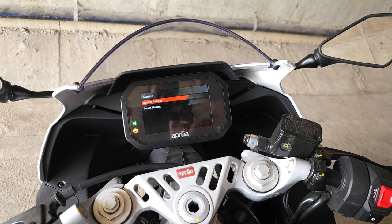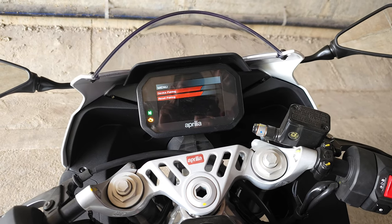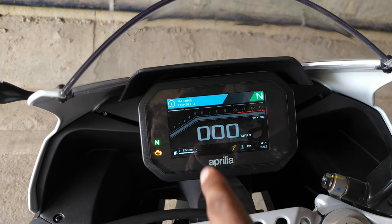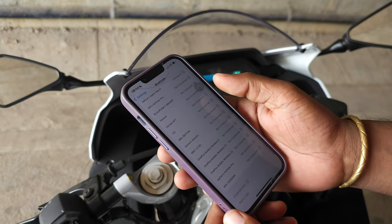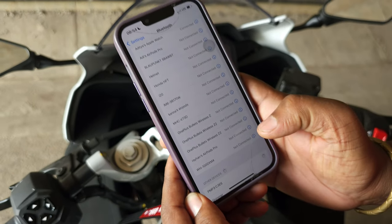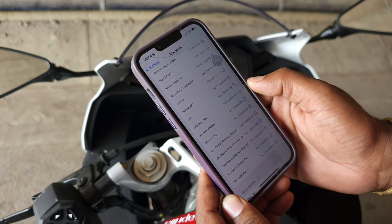Once in multimedia, there are two options: device pairing and reset pairing. Since this is the first phone I'm connecting, I'll select device pairing. If there is a phone previously connected and you need to change it, go to reset pairing. I click the right arrow button, which is the enter button. It shows pairing enabled. Now I go into my phone, open settings, and check for Bluetooth devices. It shows a device named PMP3CE36. I click on pair and allow whatever contacts and permissions it asks for. It shows pairing completed.